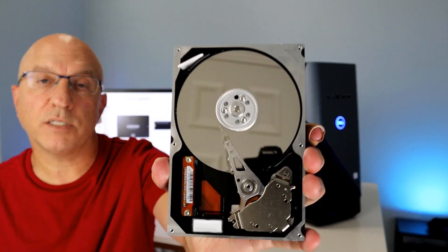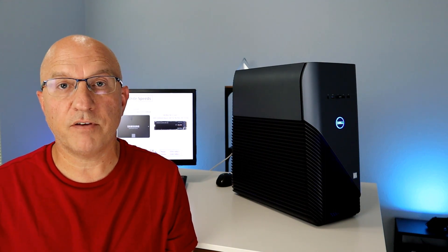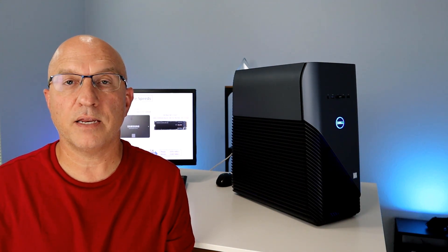Let's summarize what we did in this video. In the PC behind me, we took out an old 3.5-inch hard drive — loud, noisy, and slow with all those moving parts — and replaced it with two new SSD drives. We used Macrium Reflect to clone the old hard drive into one of the new SSD drives. The speed tests showed just how fast those SSD drives are — the 2.5-inch and the NVMe M.2 drive were so much faster. The top reasons to upgrade to SSD drives are speed, performance, and reliability. The whole process was pretty easy, and I highly recommend replacing old 3.5-inch hard drives with new SSD drives.